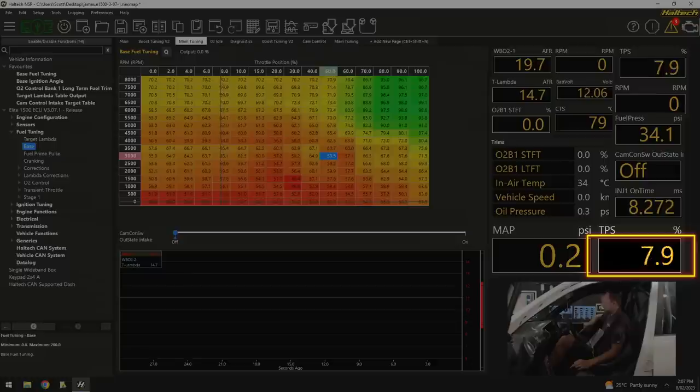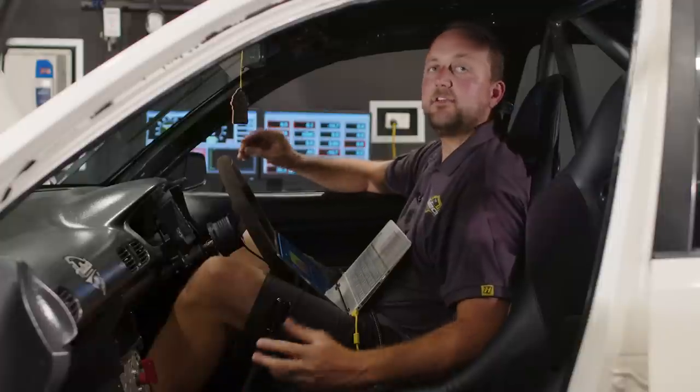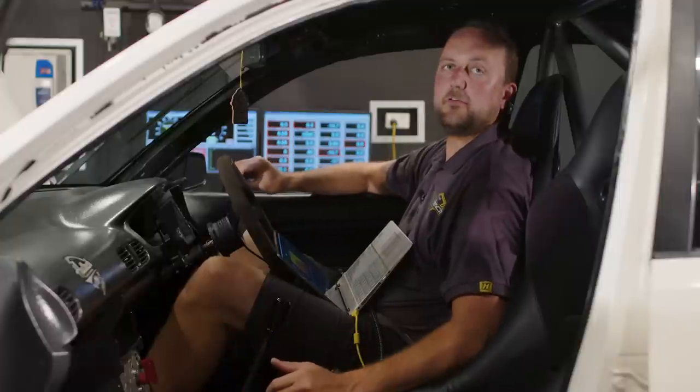At the moment, it's referencing 8%. And that's because it's using the idle control circuitry. So the idle controller at the moment is holding that throttle body 8% open in order to do the post-start, or in order to get the thing up and running. As soon as it fires up, it's going to come back and idle at 1 or 2 or 3% of throttle body opening, because it does take into account the idle control requirement.